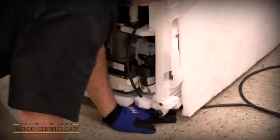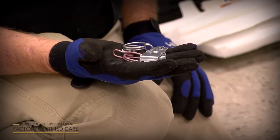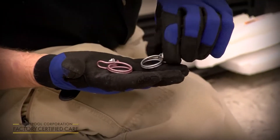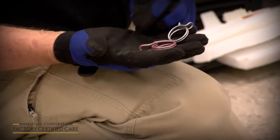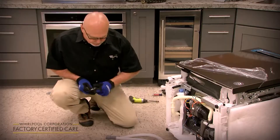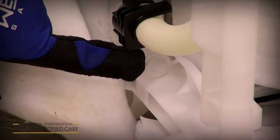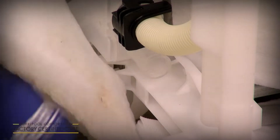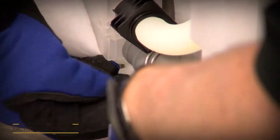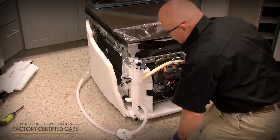Route the power cord down the back and out. The next thing to hook up is the drain hose. The miscellaneous parts bag in the literature includes anchors to anchor the unit to the cabinet, two clamps (a silver and a red one), and two anchor screws. The red clamp is for the end of the drain hose that goes under the sink to your disposal; the silver clamp goes on the 110-degree elbow end at the bottom of the dishwasher. This model line has a new drain port connection on the left side rear of the unit.